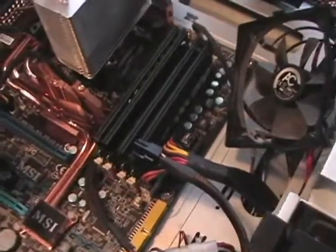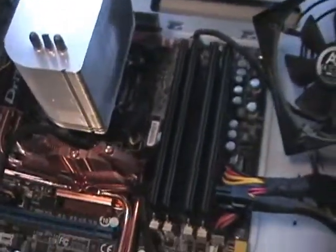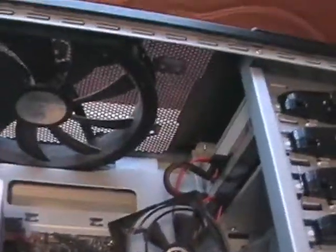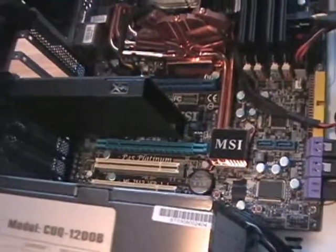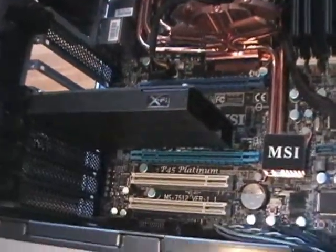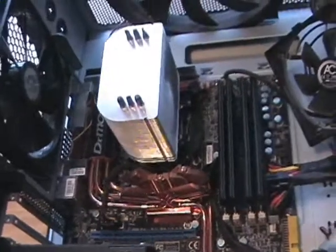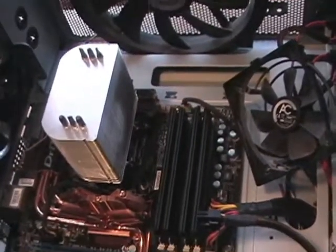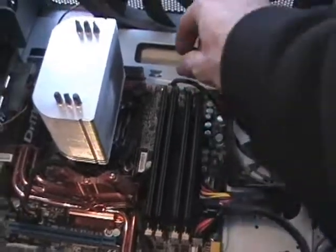Also, make sure you're not bumping into things — be extremely careful when you're doing this. After you're all done cleaning, even if you didn't take anything out, always go back through and make sure your RAM is still seated properly, your sound card and video card are still all in place. A lot of people clean it out, start showing it off, bump something without even realizing it, go to turn on their computer and boom — nothing works. Save yourself the headache: take a few more seconds, re-push down all your memory, and make sure everything is as it should be.